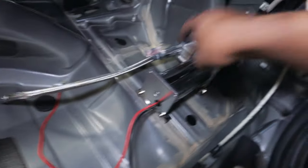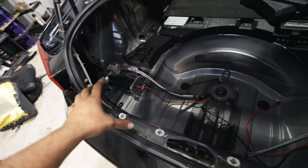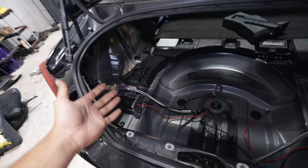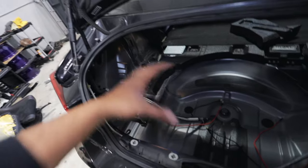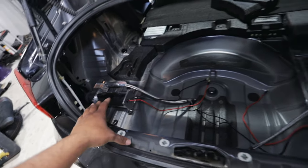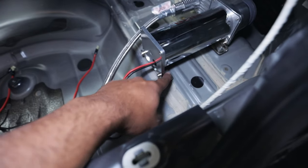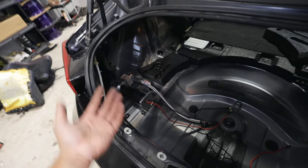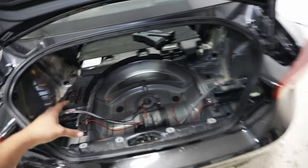Both compressors are secure and we're good to go. All I did was drill a little hole and put in a screw. You can drill a hole, put a bolt through and use a nut from underneath — yes, you can do that. But I've done this method many times and had absolutely no problem. Just make sure you put a washer down so you don't go through the rubber grommet. If you feel more comfortable with a bolt and nut from underneath, do that.